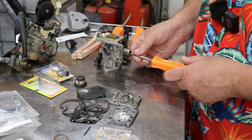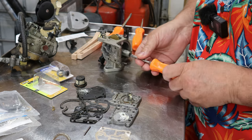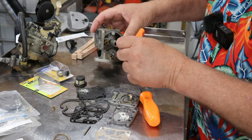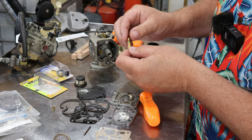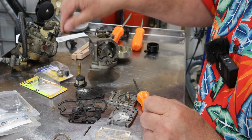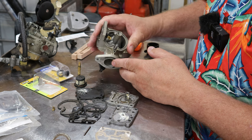It's nice to take everything out you can, just so even if you flush it out there could be trash trapped on the other side. I can see some stuff coming out there. This actually looks pretty nice and clean - cross holes here. You're looking for a nice round hole through there; if it's not round that means there's trash in it. So we got those two jets out.